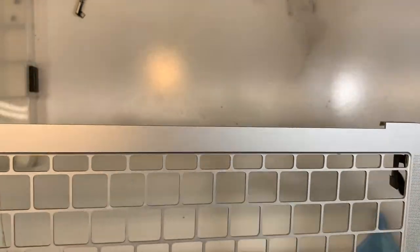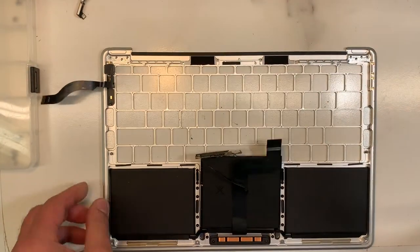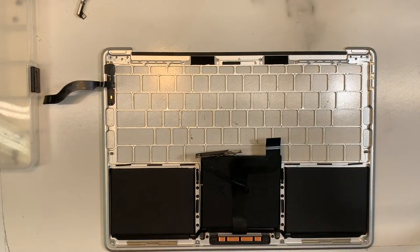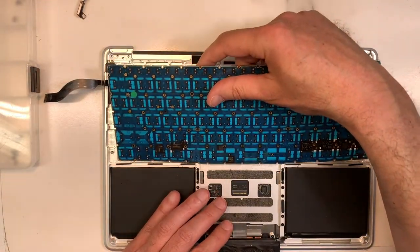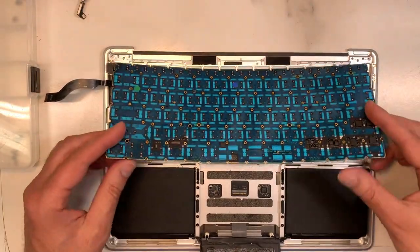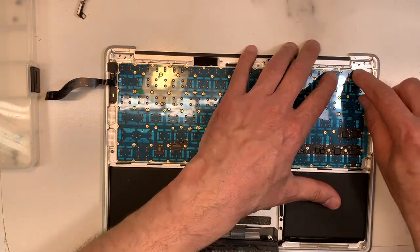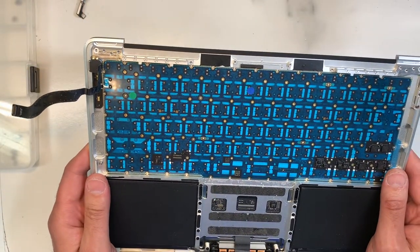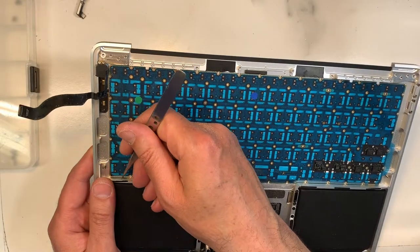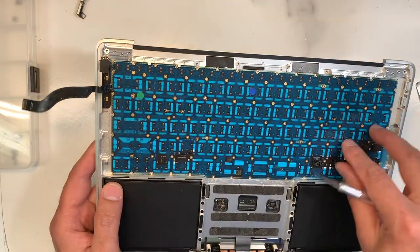Okay. Good. Okay, now we can put the new keyboard back. Sometimes you have to jiggle with it a little bit. Now I should mention some of the corners. This corner over here and that corner over here had some thick, heavy glue that Apple put to secure the keyboard at the end. So if you put your keyboard back and it doesn't fit properly, it's because of that.